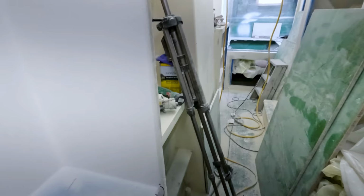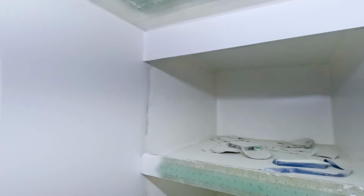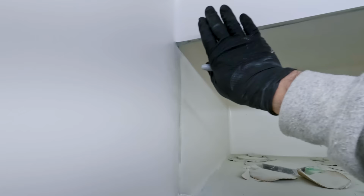And then we do have this little area needs to get addressed again. This will be covered by the door trim coming around here, but you're still going to see that. So that needs to get filled in. And then we will have the doors overlapping this. So this will be covered, as will on that side. Now just a lot of sanding in my future. It's gonna be a tough day, but I am gonna use that new Flexisander, and take away a lot of that longboarding, the hard stuff for me. But the thing still does weigh 7 pounds, so it is heavy, but it's still a lot easier than just longboarding it.